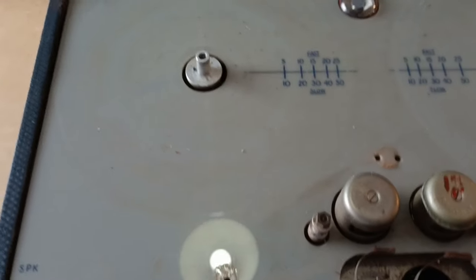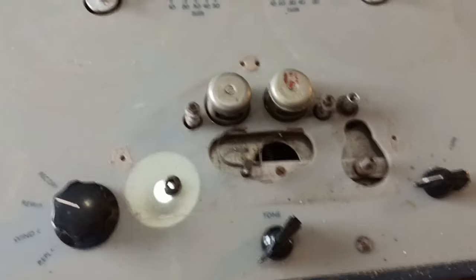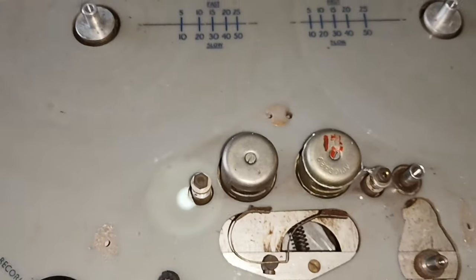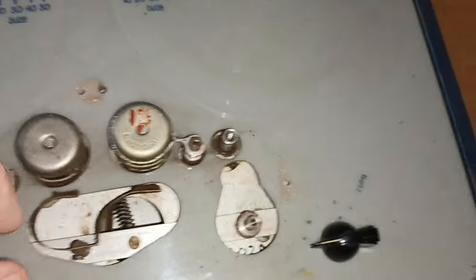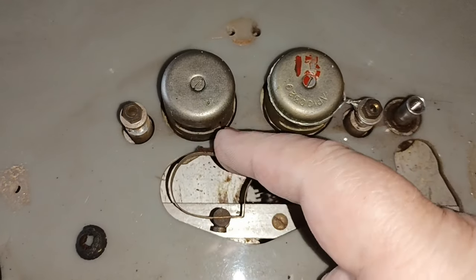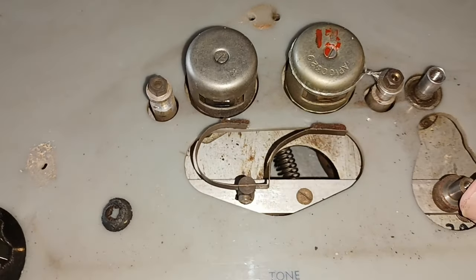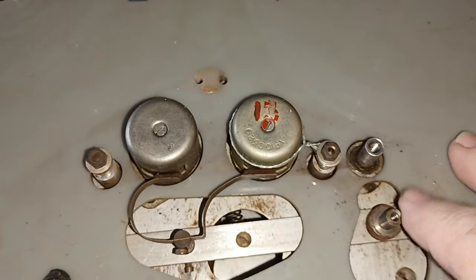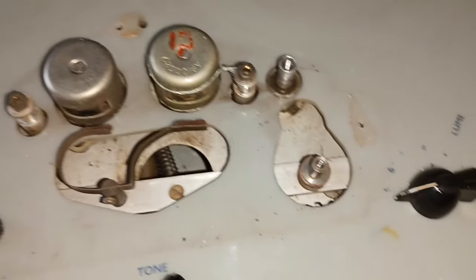You can see on here there's a record head, a playback head, and there's the felts and tone control. Up the top is a magic eye, which is what was used to set the record levels. We're back on to just having a look around here. It's quite interesting the way these felts have aged — they're not the fluffiest they've ever been, but they still actually are felt. Mechanically, it appears to actually still be moving bits in the right position and things.